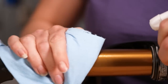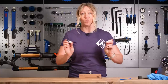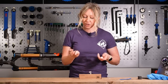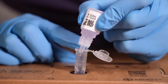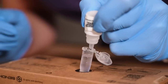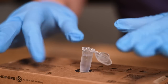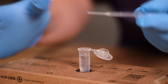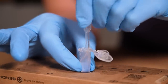We just need to clean this off with an alcohol wipe or some isopropyl alcohol. Now it's time to shake up your epoxy resin and your hardener — this is a two-to-one ratio. I'm going to use one mil of epoxy resin in my pipette, which has measurements, to 0.5 mil of hardener, so you'll put one mil in and then another 0.5, taken up to 1.5 in total. You should have your gloves on by now, and then we're going to get a stirrer or a pipette and ideally stir this for about three minutes.